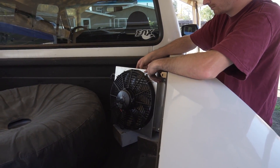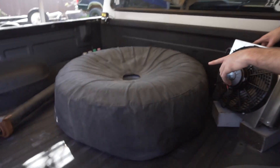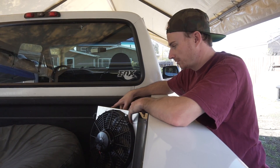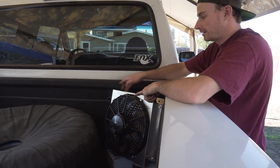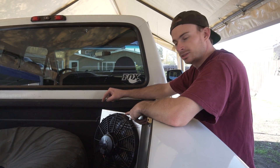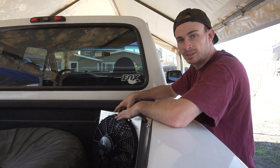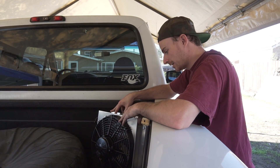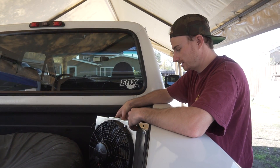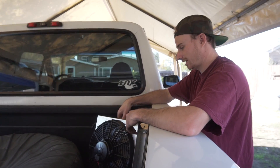So what's your plan with mounting this — at a certain angle or how are you deciding where to position it? I got the spare back in the truck. Got the cooler just kind of sitting up here roughly where it's going to be. I know the two lines — I have two 90-degree fittings on here so both of those have to go down through the bed. We have to drill holes in the bed, so I want those to be on the inside of the frame rail. I'm just trying to get everything where it needs to be and then figure out a perfect way to mount it. I have some little tabs that are going to make it a lot easier.